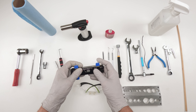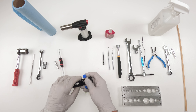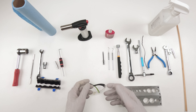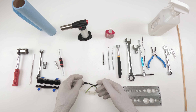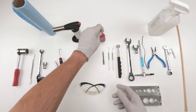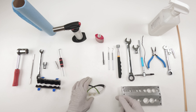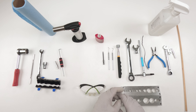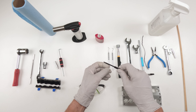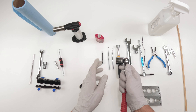You're going to need a soft jaw with a nine millimeter shaft hole in order to take out the air spring. You're going to need heat to remove that bottom nut, and Loctite red to put it back in. Always safety glasses. Now for the damper side — first we're going to need a 2.5 millimeter Allen to remove the top cap dial screw on top that's holding the dials in place. Then we're going to need again a chamferless 26 millimeter socket to remove the entire damper cartridge.